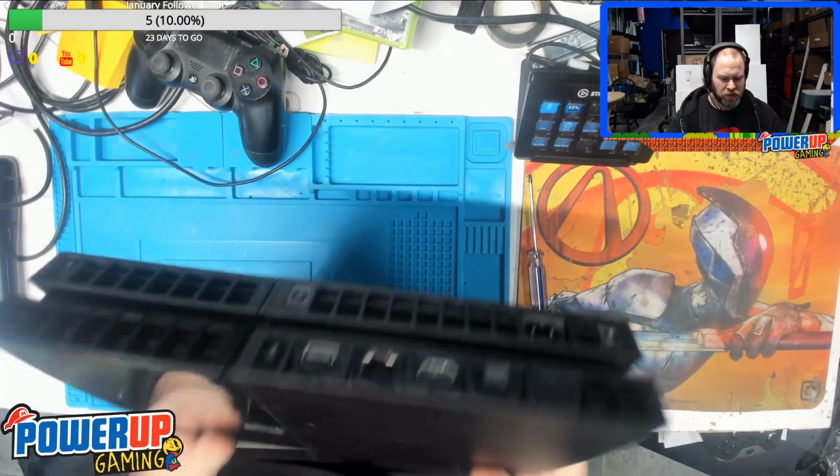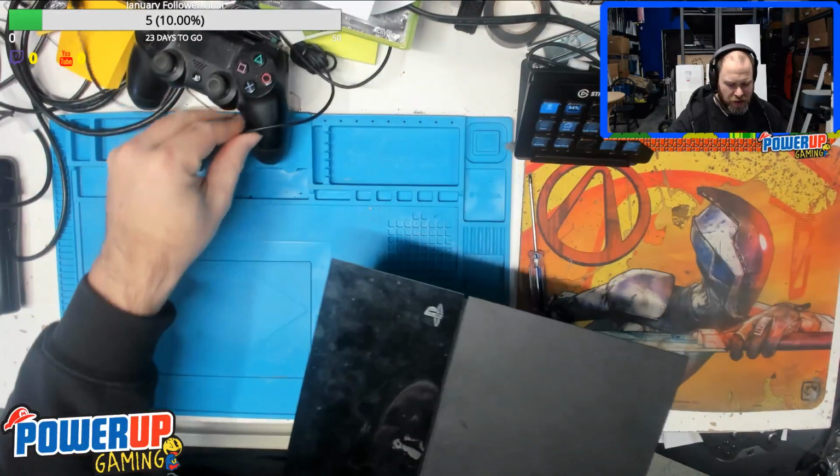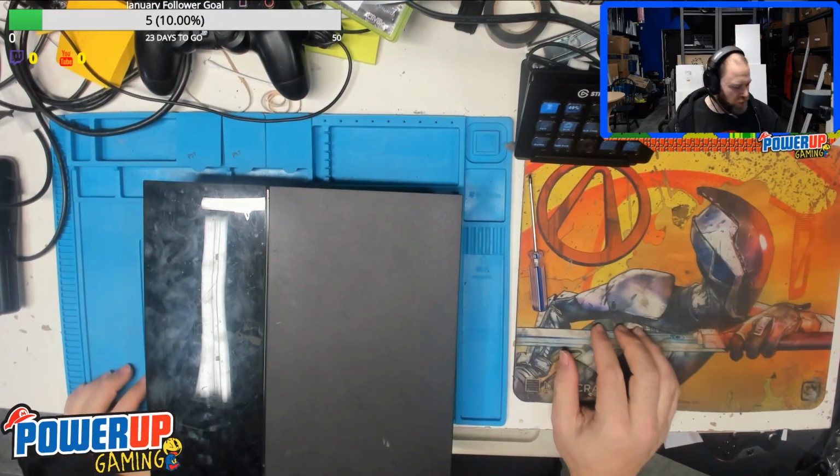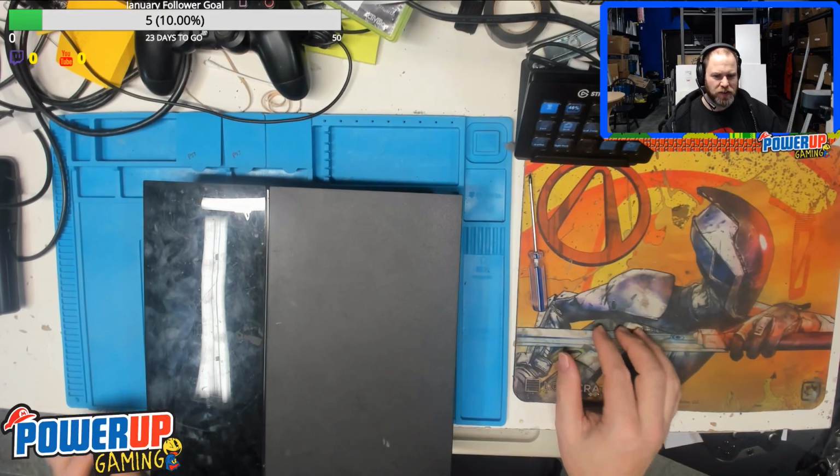What we notice in these situations with the customers is they tend to open it because something else is wrong, or they want to clean it out or whatever, and they don't do the maintenance properly. So they don't change out the thermal paste, they just assume the standard thermal paste is going to do a great job. And it doesn't.